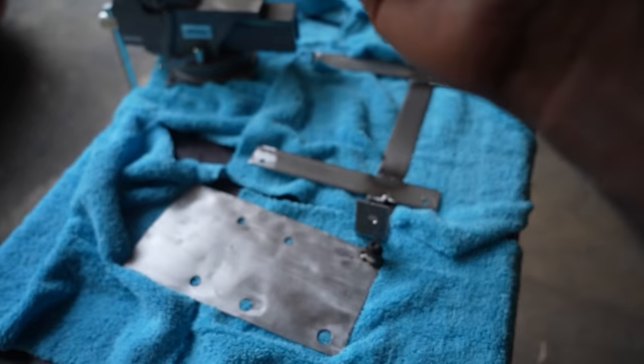And this one here, the 15, is the one that I'm going to use because this is the one that's giving me the continuity. All of these three, one, two, three, are giving me continuity, so I can tap in either of these. But because I can see the controller requires 15, I'm going to use this 15 one here.